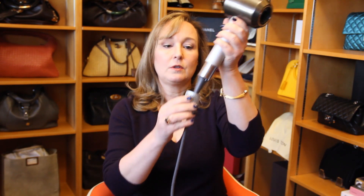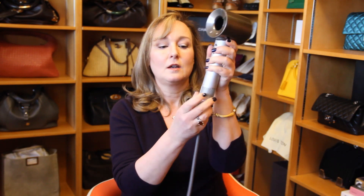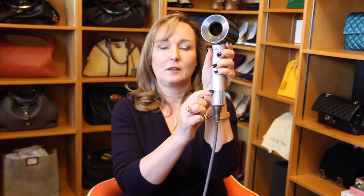If you don't clean it, you may blow your Dyson out eventually. This stays on the cord when you do that, and then you just push it back up. There's a little red dot that has to line up. On mine, there's a red dot in the front on the filter and a black dot in the back, so you just twist it off and then put it back on.